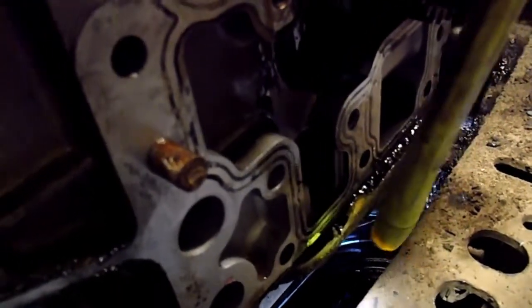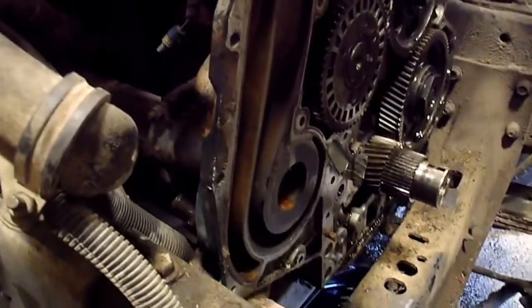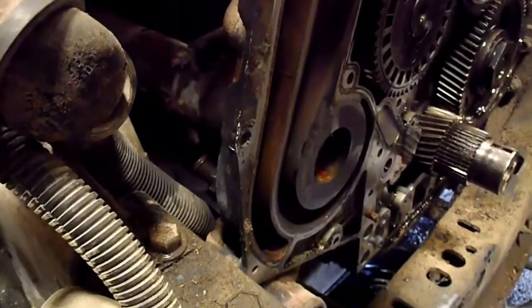After I did that, I had to get a screwdriver and just tap this way from underneath, tap forward, to get it to come off, because it was stuck so good, like I missed a bolt. It was coming off on the top here. I could push it open, and it loosened. Just really, really gently pry on it, and it'll come off. I've seen some videos where they just fall off, but this one didn't. That's where it was sticking, on that oil pan gasket at the bottom.